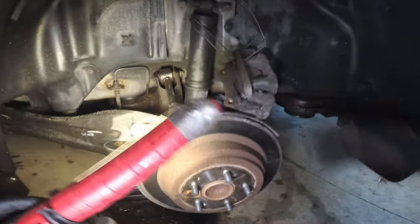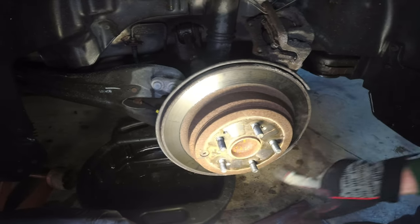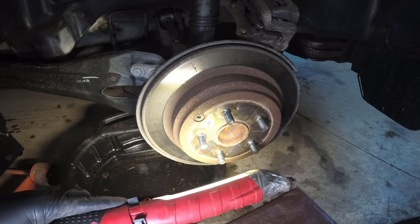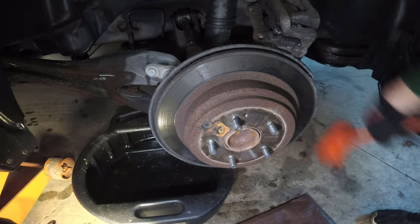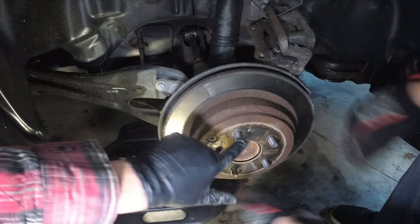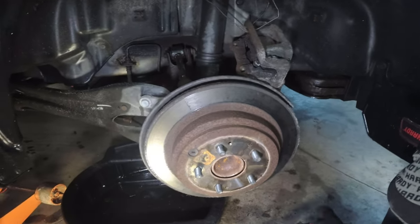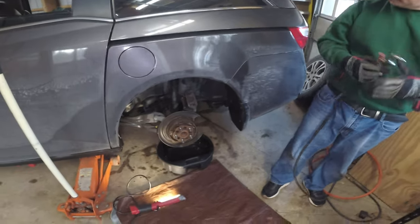With the caliper secured, we take a look at the rotor. These rotors have been off before — check if it's loose and has any wobble. The emergency brake pads are on the inside with a rubber grommet you can remove to loosen them if needed. These are special rotors — you can run a bolt through the holes here and drive them in to help bring the rotor off the back of the spindle. Hold your breath while doing this to avoid breathing brake dust.